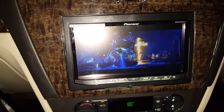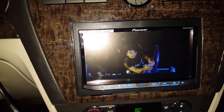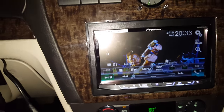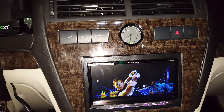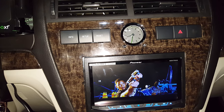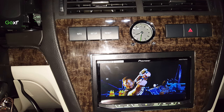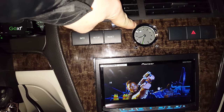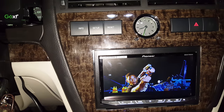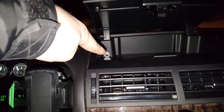So it's a really simple bypass. It doesn't cost you a whole lot if you have simple electronic know-how. It's very easy to maneuver. Basically, you have to make sure that you have two prongs. Those two prongs — one of them is going to be for the Pioneer's green wire, that will be your parking brake wire. It goes on one side, and then you just use a piece of wire and find yourself a grounded source. I own a 2009 Mercury Milan — I have a grounded source back here behind the clock. So I hooked my ground to the clock, which doesn't interfere when I turn my lights on or anything like that. Then you just need to find a spot to mount your switch. You can mount it up in front here, you can mount it here, wherever you want to mount it. I decided to mount it up here in that little cubby hole so it's out of the way.